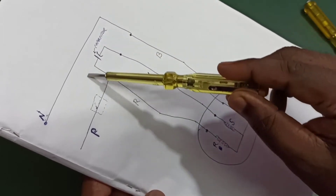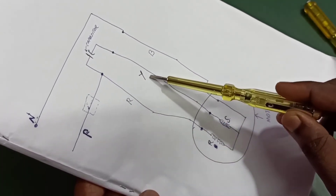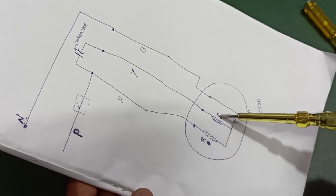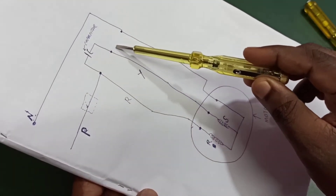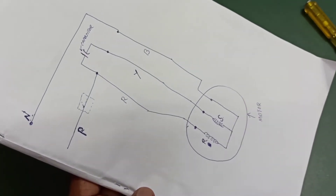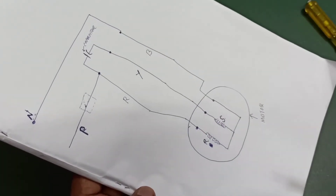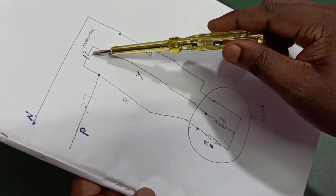Here you can see one capacitor. This capacitor is connected to the red and yellow cables coming from the motor's run and start windings. Please note the location where we connect the capacitor. This starter will not work if this capacitor is damaged — in that case we need to replace it. We need to remove the existing capacitor and add a new one.